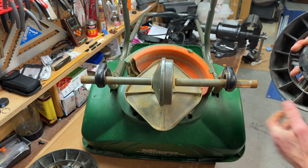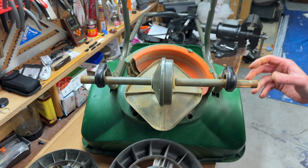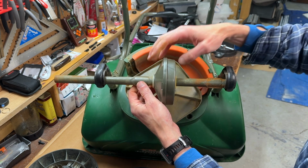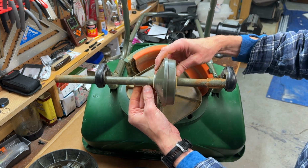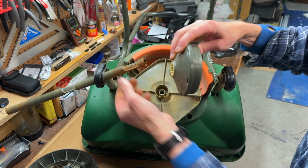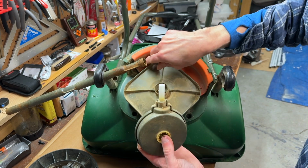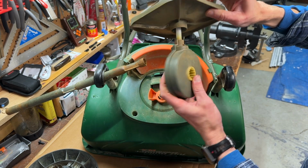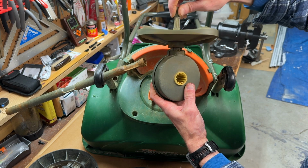These wings on the axle slot into the inner wheel hub. So as the wheel rotates, the axle rotates. And then as the axle rotates, these, I'll call them wings here in the center, engage the cogs of this gear, which in turn spins the hex-shaped shaft atop it, which, encompassed by this hex-shaped receptacle in the impeller, rotates the impeller. It's kind of like a game of mousetrap.